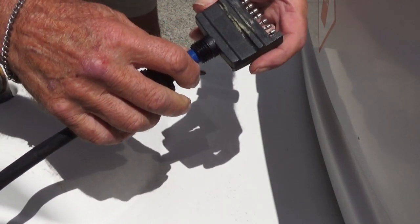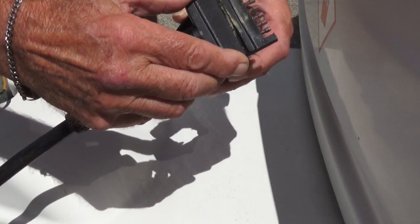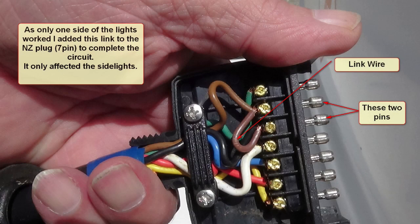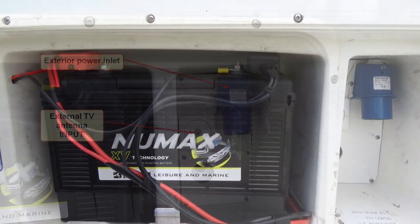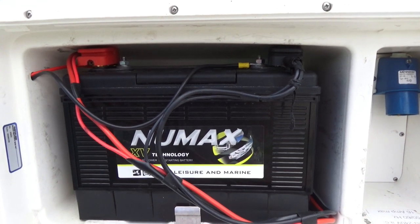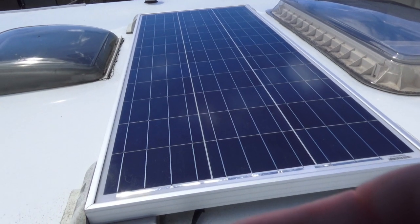As you know, English caravans have 12 pins normally — we only use seven pins here in New Zealand. I did have some trouble as one side of the van didn't work on the side lights. I had to put a link wire in to make that work. That's where you plug the power in and also the battery in the sealed compartment to the outside of the van. We're talking about electrics.